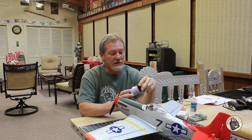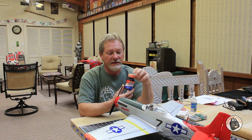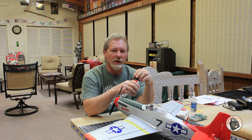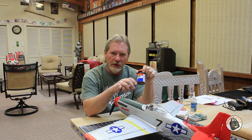So I was thinking, what can I use in its place? And I came across the rubber cement. On the retaining bolts, it has a little brush applicator and I just coat the last 10 millimeters of the bolt with the rubber cement. Then I put a little dab of it underneath the head of the bolt and run the bolt in.